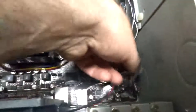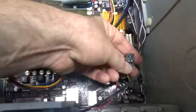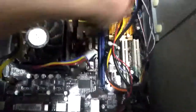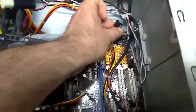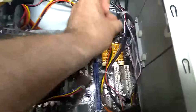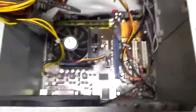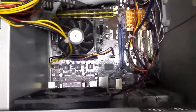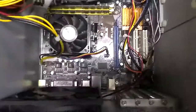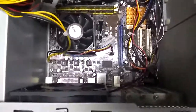I mentioned the FireWire doesn't work — here's the FireWire plug and here's the other end of the FireWire. If you plug anything into the FireWire on the outside, this is where it would plug into the motherboard — but it's not connected at all, so it doesn't work. Each time you see a plug on the outside of a computer, there's a wire on the other side that connects it to the motherboard. If that wire is not connected, then that plug on the outside doesn't work.